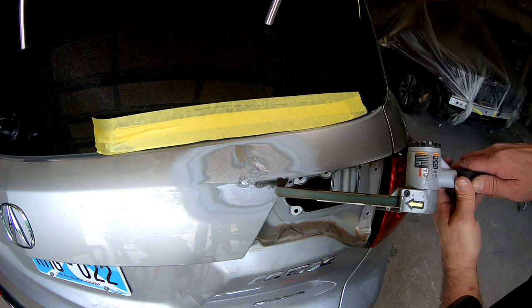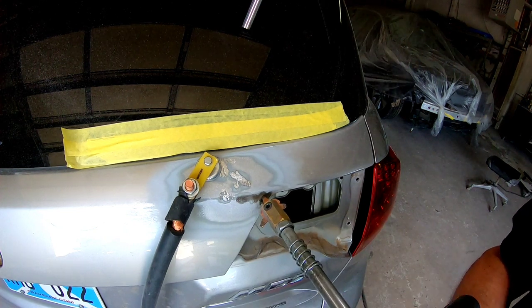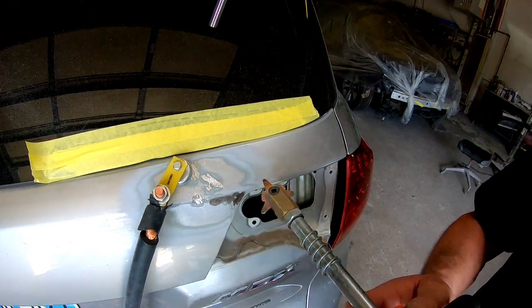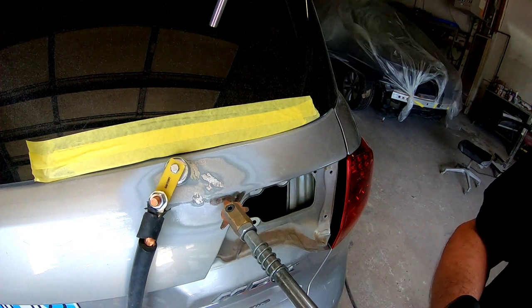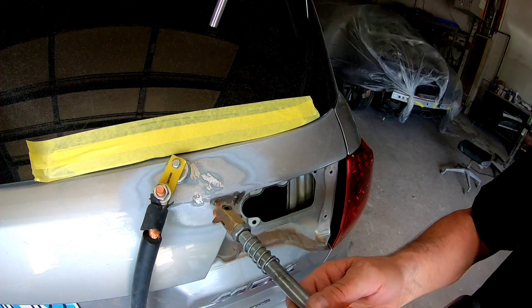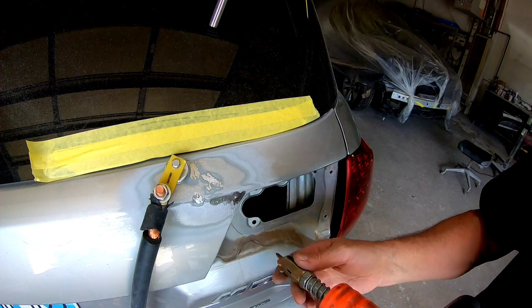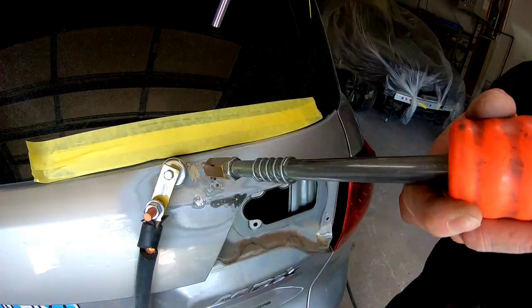Now I'm going to use a tool called the G90E, and what this essentially is, is a welder with a slide hammer attached to it. It welds the tip in the center of the low area, and then you can slide hammer or pull it out. This is a really good tool to refine those small repair areas and do the finish work on a dent. The G90 is an inexpensive option to what's usually a very expensive tool. If you want to learn more about this tool, check out my review and demo of it. I'll leave a link in the description.